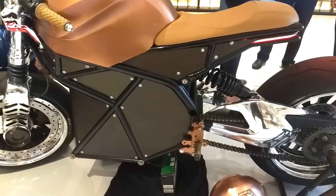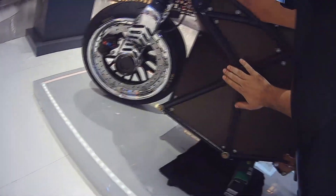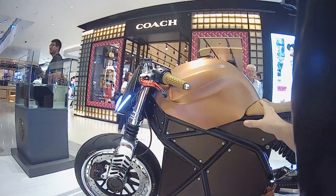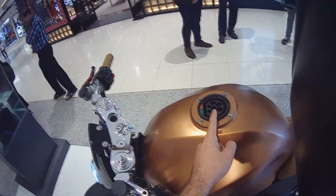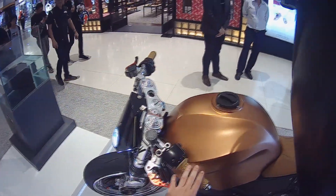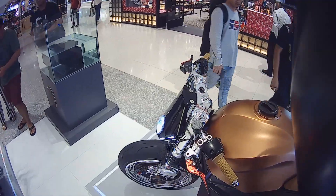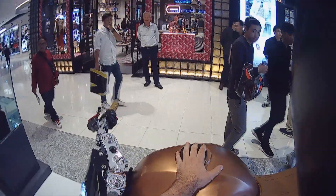I like how it looks actually, because it looks very rugged, and that aerodynamic split here looks really cool. They tried to replicate a gas tank over here, but this is where the charger will be. They're currently thinking of only AC, but I've been suggesting to them to do DC fast charging — try to get 400 volt architecture, because that's the only way to initiate DC fast charging, and that will bring down the time. Currently they're saying 2 hours for a full charge.